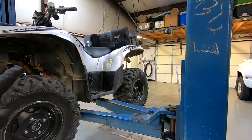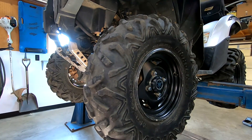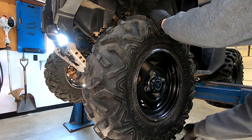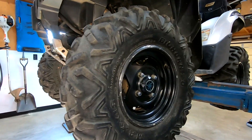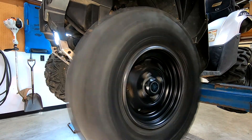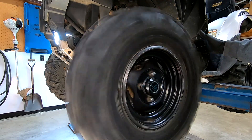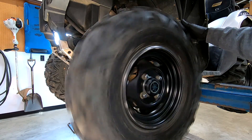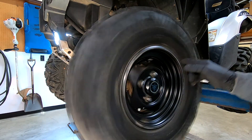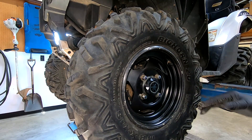Get up on the left and there's something else I noticed when I put it up here. This wheel bearing is not loose, there's no play in it, but if you listen real closely — might turn up your volume — you hear it roaring. That wheel bearing is rough, making a roaring noise. That wheel bearing is noisy, so I'll get some wheel bearings ordered and we'll do that video next.